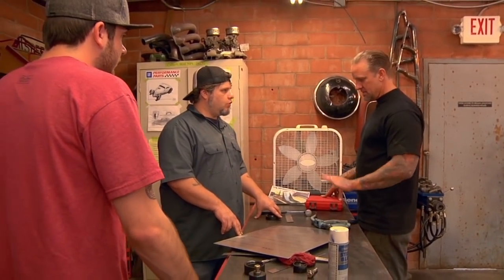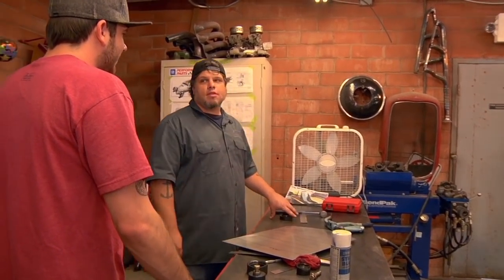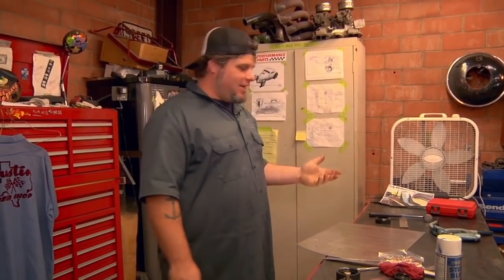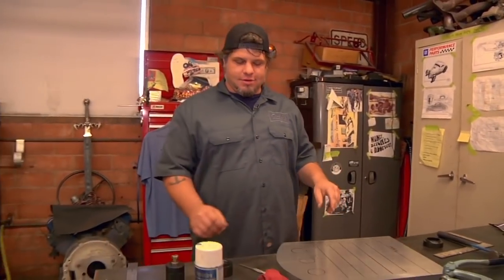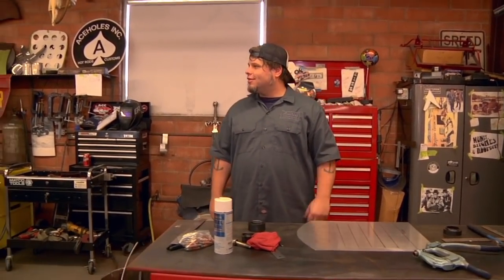All you have to do is bend it 90 degrees. The metal has a memory — it'll go right back to where it was. That seems insane to me. But if you have a planishing hammer you don't need to worry about it. Have you ever seen a dent in an old car and you pop it — it's been there 50 years and it pops right out? It's just hard to do that. No it's not — watch, I'll show you. Don't be scared.